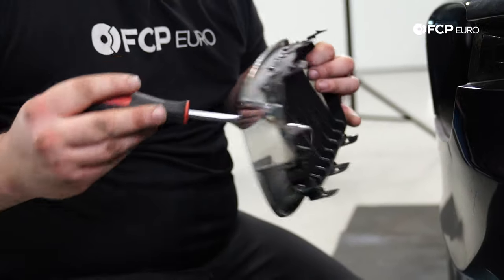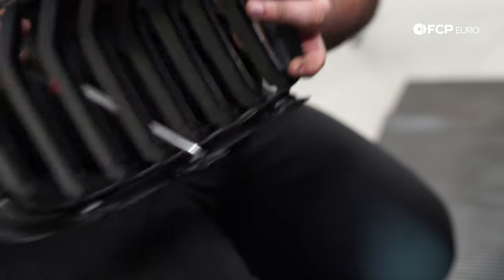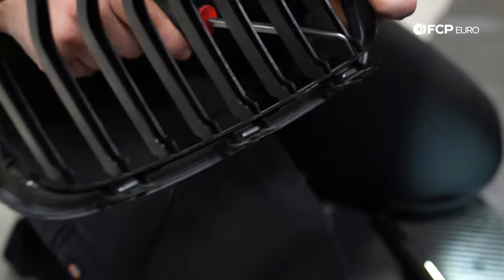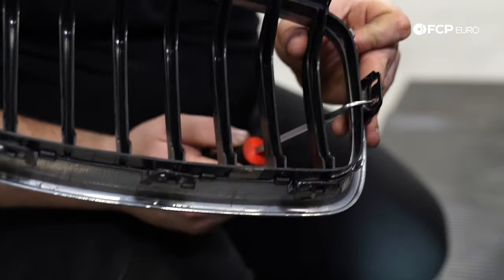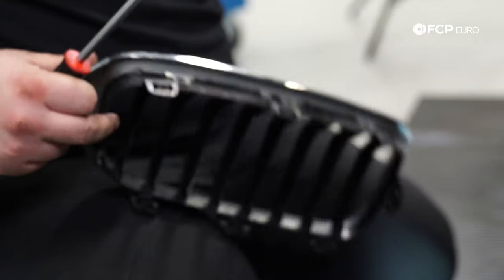As I'm releasing the tabs, I want them to come out of their location. I was able to take this angled pick, reach down in between the slat, and pull up like that. I was pulling the grille forward as I was doing it, therefore helping it release. And then this one in the rear, I did the same thing — I just came in from the side, hooked it, pulled it forward, and was able to release it.